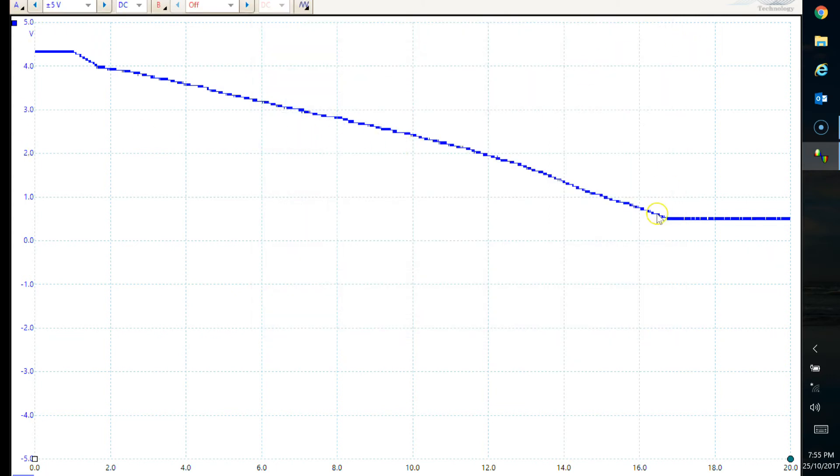Back to the bench. There you go - I think that was a reasonably short video. Really useful little test. Now obviously using an oscilloscope to test a TPS unit is a bit of overkill to be honest, but if you've got one - and you saw how quick it was to set up - why not use it? Then you've got conclusive evidence as to whether the TPS sensor is faulty or good. Your call - that's what it's all about as a mechanic. I'll put a link in the description for where you can buy PicoScopes here in New Zealand.